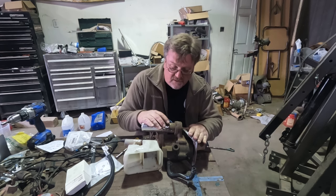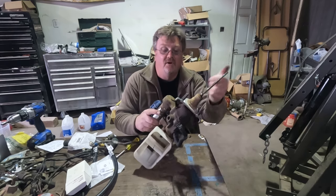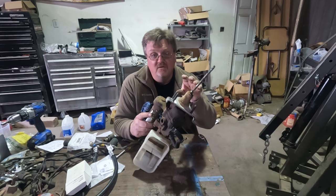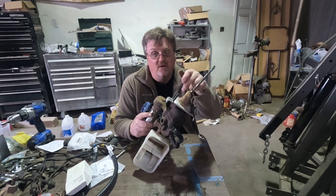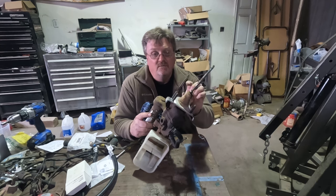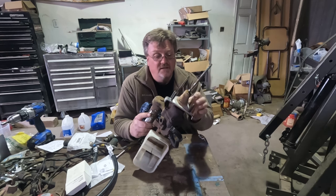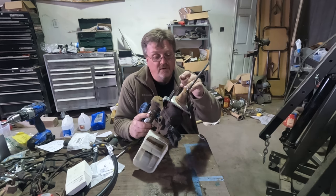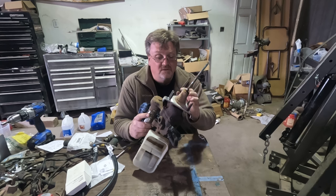This angle plate is going to be an issue. There's one big nut at the end — I can just undo that nut, pop it off, and the plate comes off. People have used the older flat-plate style with a spacer to mount to these Jeeps. I'm debating whether I can cut the inside out and weld it to a piece of tubing to make my own spacer and plate at the same time. But if I put it inside tubing, that nut won't go back on — so scratch that idea, we're doing something else.